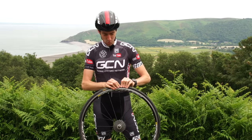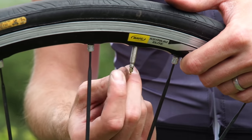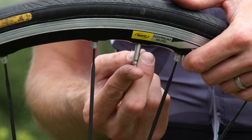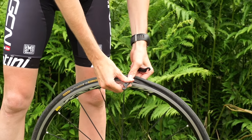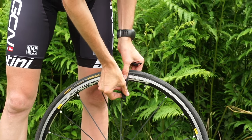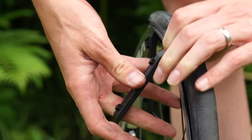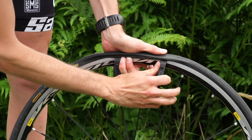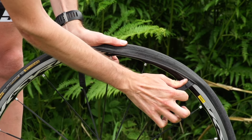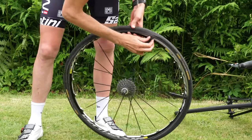It's time to remove one side of the tyre — you don't need to take it off completely. First, make sure that any air is completely out. Take one of your tyre levers and get it in underneath the beading on one side of the tyre. Take your other one a few inches further around, basically where you can get some grip underneath the bead. Sometimes with tyres you can just start to slip your tyre lever around and it will fairly easily come off all the way around.